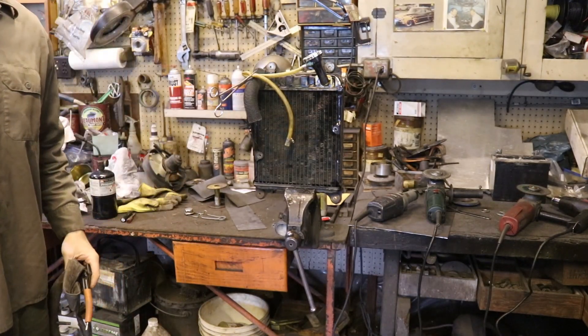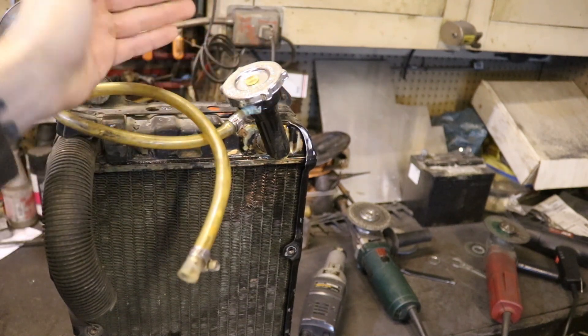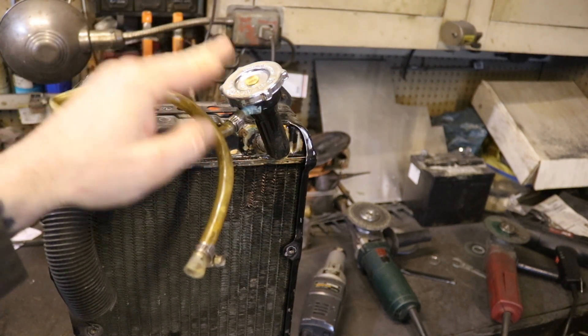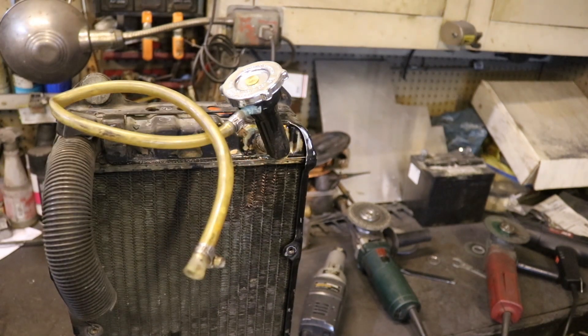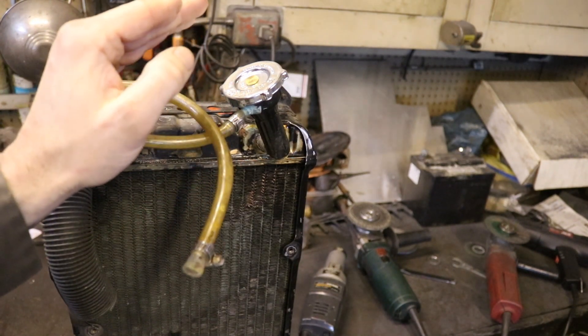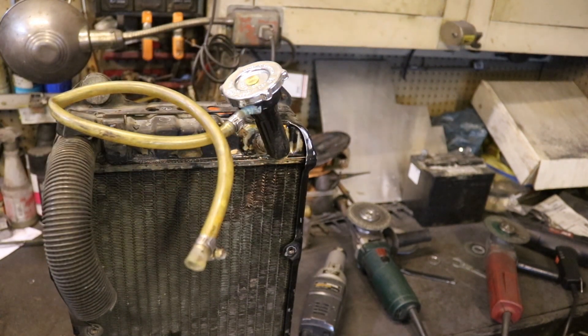No leaks — we are happy! My other bit of news on this radiator cap is that for a GL 1100 1982, at the very least, this radiator cap can be had for less than $5 at an auto parts store — that's how I got this one. If you look online specifically for Honda GL 1100 radiator caps, they're $25 to $30, but there's an extensive crossover with the automotive industry on this particular radiator cap, so they can be had off other vehicles very cheaply. I'll put a link in the description below to cheaper ways of getting this and also a list of some of the vehicles this radiator cap is also used on.